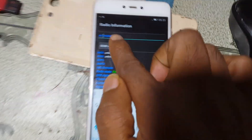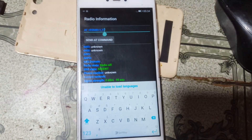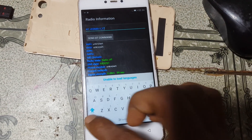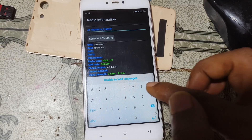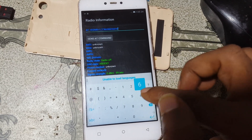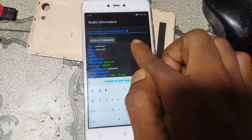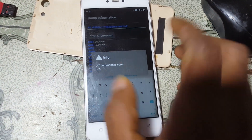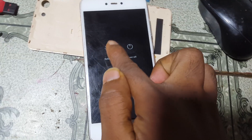Give a space, and at the end you will see a comma followed by a quote. You need to go to that position and type your original IMEI number between the quotes. Now tap on Send AT Command and you will see AT command is sent.